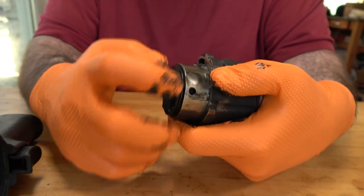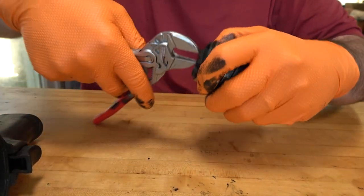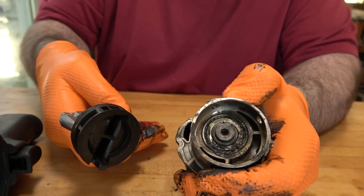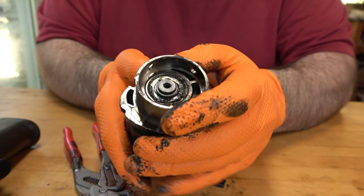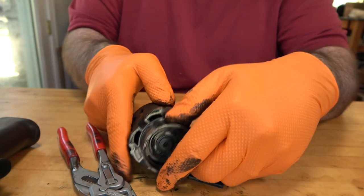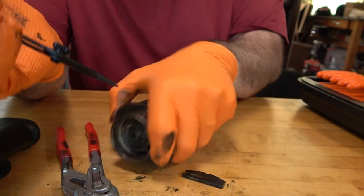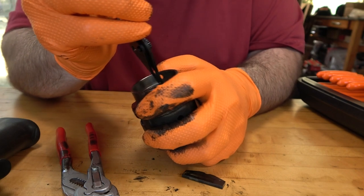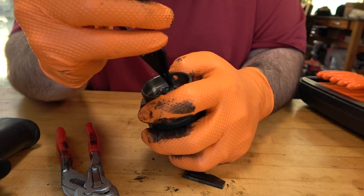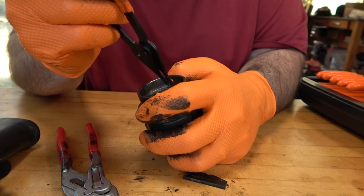Next is to pull the selector switch off the back — that just pops off. Sometimes it's easier to use a pair of pliers: just grab it and pull. There's another bearing in back here, and the rotor is held in the assembly with a snap ring, so you'll need a pair of external snap ring pliers to pull that off. These are the Lang snap ring pliers — you can adjust these to be either internal or external. The snap ring has some pretty tiny holes in it, so you have to make sure you have the appropriate size tips on the pliers. The tips on these are 38 thousandths of an inch and they fit in there just fine.